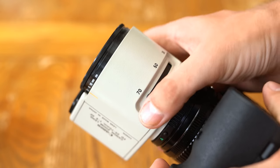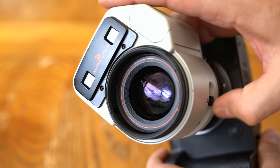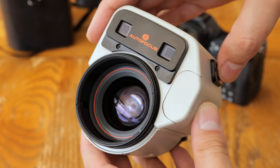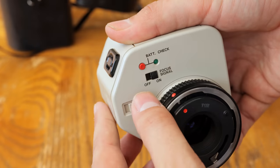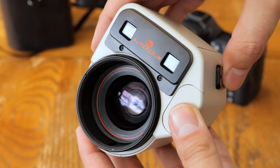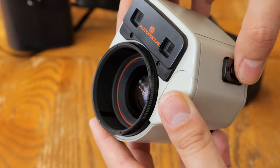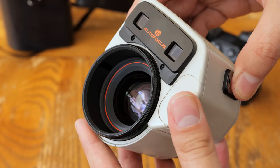On the bottom, there's the zoom control — it works with a little rubberised lever which doesn't turn very smoothly. Here's the autofocus at work. That confirmation beep can be turned off by means of a big switch at the rear, where there's also a battery check light. The motor works a little slowly with a clear whirring noise, and there's no option for continuous autofocus. I found the autofocus system to work about 75% of the time with this lens.